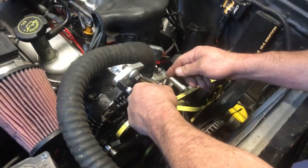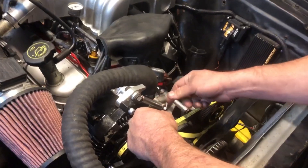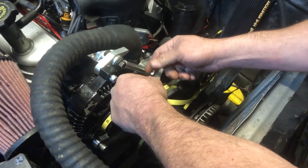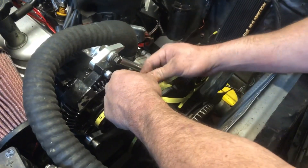This is still not going to be quite exact — it's going to be more exact with something like a rod tensioner because it's rigid and it's not going to really move. But with a spring-loaded tensioner, you're going to have a little bit of give either way. So after you get this measurement, you might still want to go to a parts store and get three belts within a half inch of each other.